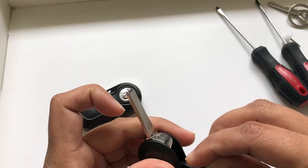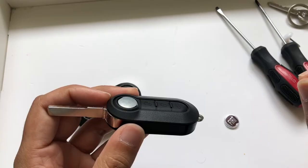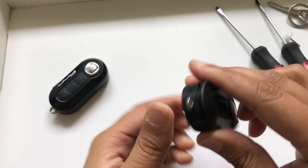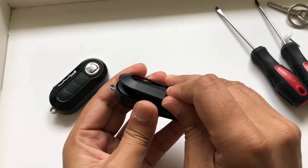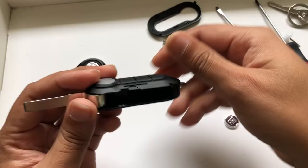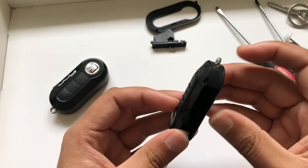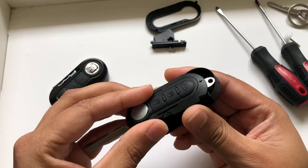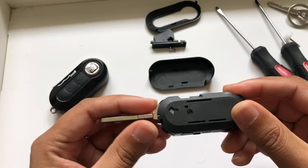We have to change this key — I'll take all the inside material, the key and batteries etc., from this older key and put it in this newer one. I think it's already open from inside. I'll show you how to open this one. You have to open this cover first — just be careful and don't break these small clips. You have to drag it like here, and there is a screw you have to open.